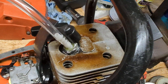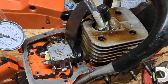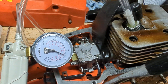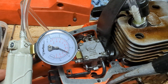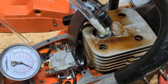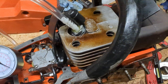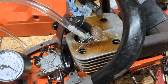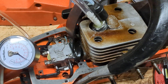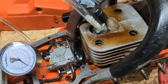What's your experience? Do I need to get the 8500 and put pressure in to see where it's coming out? Once it gets down to 10 the leak slows right down — the less vacuum, the slower it goes. Would you just run it like this? It's not falling that fast, and when you're running at 10,000 rpm it's in vacuum for only a split second.